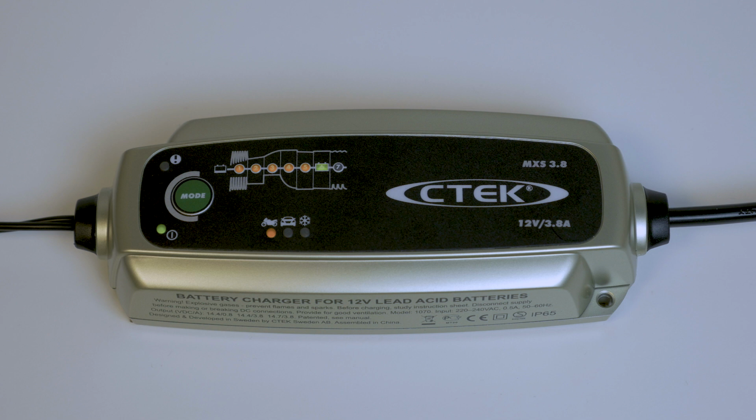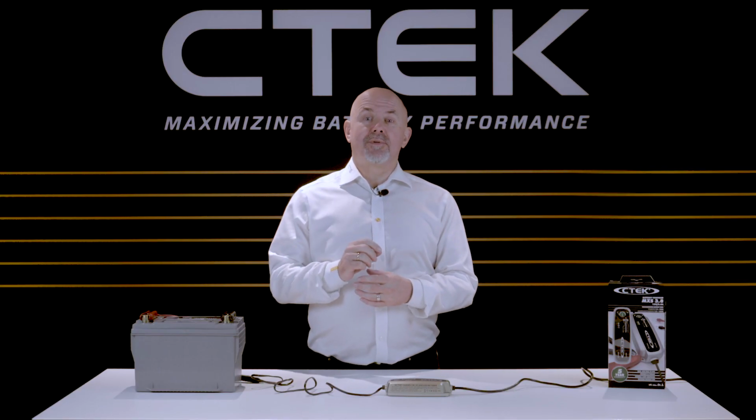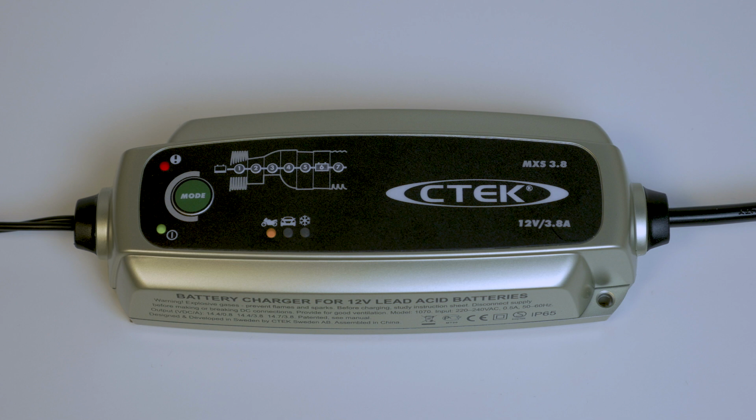Now, like all Ctek battery chargers, the MXS 3.8 is extremely safe and reliable. It's short circuit proof, splash and dust proof, and if you accidentally touch the clamps together, it won't spark. But if the red error LED on the top left of the charger lights up, there are a few things you'll need to double check.